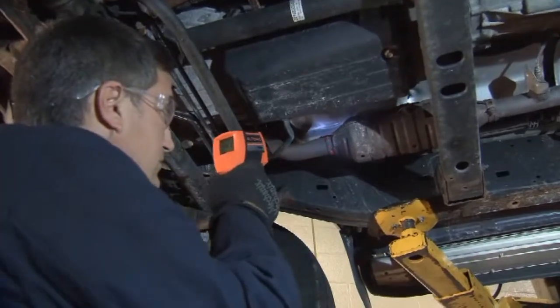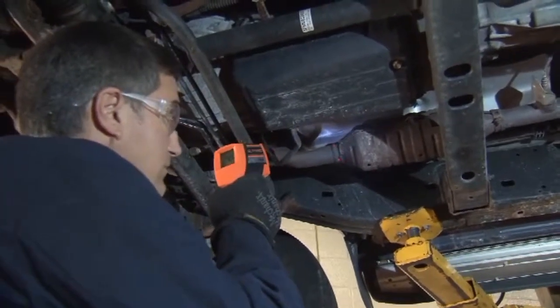Now check the rear weld ring temperature. It should be 100 to 150 degrees hotter than the inlet temperature. If the temperature at the rear weld ring is much higher — say 350 to 450 degrees above the inlet side — the converter is working too hard due to excessive emissions in the exhaust stream. Overheating will eventually destroy the converter substrate. So taking the converter's temperature helps you determine not only what is or isn't taking place inside the converter body, but also upstream in the engine.